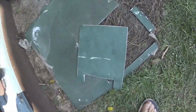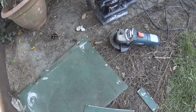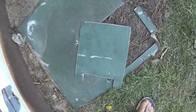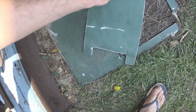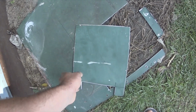Anyway, so that's that back panel sort of cut out. I'm using what I got, so it's a bit gash. I've got a 1mm cutting disc in the grinder, cutting alloy, which is a bit poor. But yeah, drilled those holes, went up and down there, gave it a quick sand. I was going to take it back to bare aluminium, but that paint is pucker, so I should just clean it up.